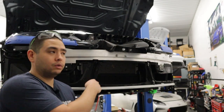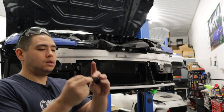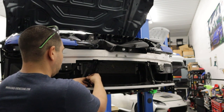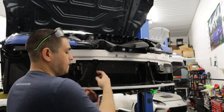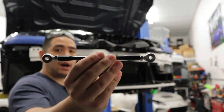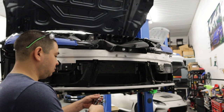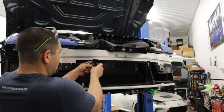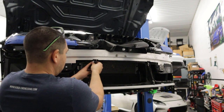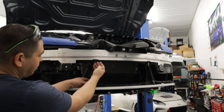Rivet nut is installed — holes drilled, rivet nuts installed, all that stuff. So we're going to take our 25-millimeter low-profile socket head cap screws and insert them into the top of the clevis for both top and bottom mounts, and simply thread them into the rivet nuts. Then we're going to grab our clevis splitter tie and assemble the rod ends to the tie rod. We have a right-hand and left-hand thread here, so if it's not going in you probably have the wrong one. Run the rod ends all the way in because this is going to be fairly tight. Line up the splitter tie inside of the clevises so you have the correct angle.